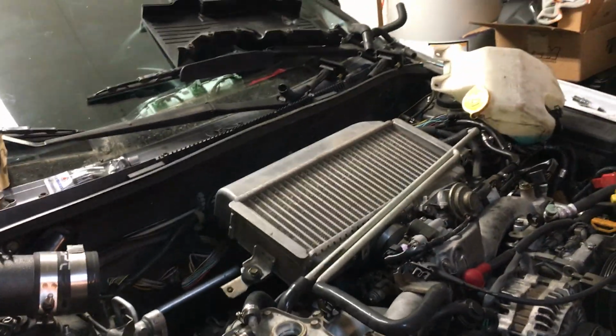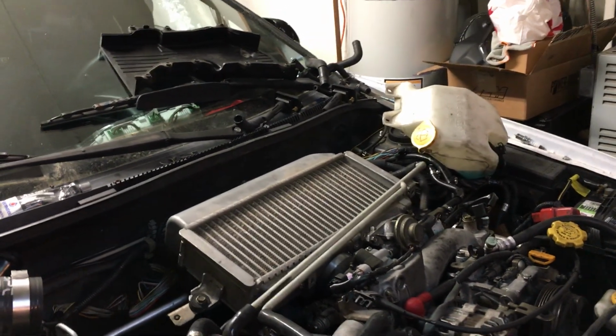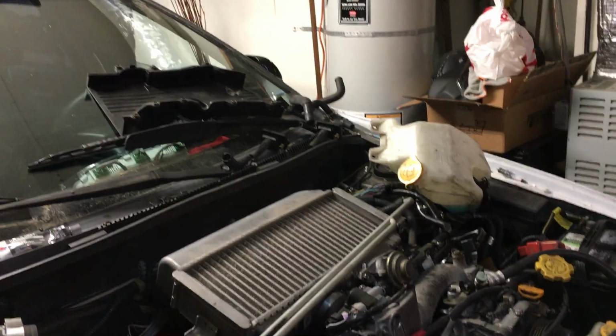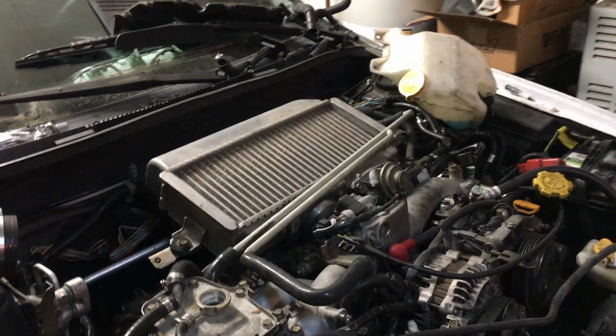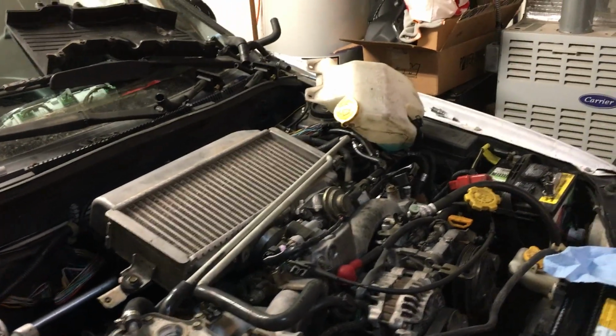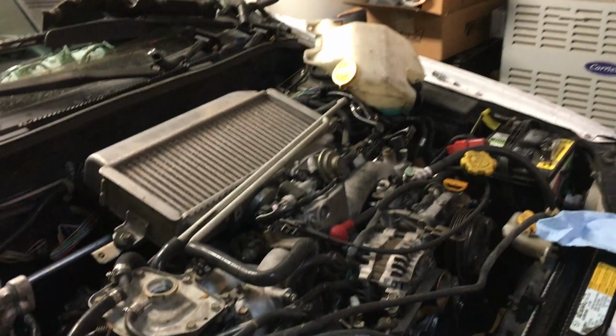Once I took that off there were no check engine lights. The idle had been alternating from about 1000 to 1500 and back down to 1000, and it started to idle around 1500 stably, and then after a minute it dropped down, but it still sounded weird.